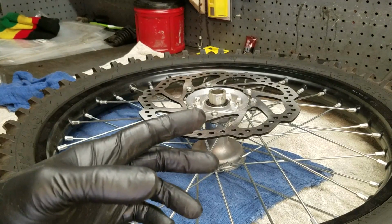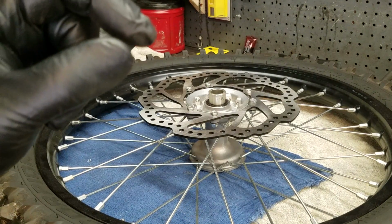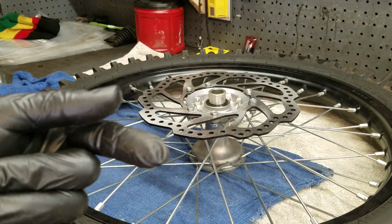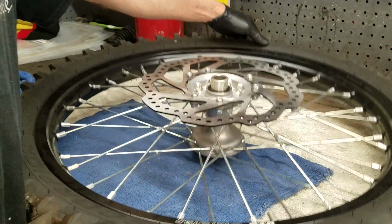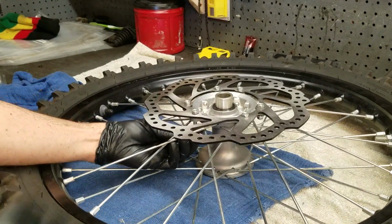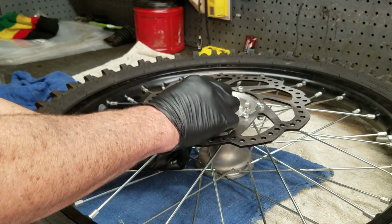If you have to change your cylinder head or your camshafts out, the cam journals and cams where they ride on the head can be scarred really easily if it's not broken in properly. So it's really important to give all that stuff some time to work itself into each other. All right, so make it a shorter ride, 8 to 10 minutes.